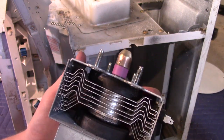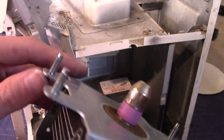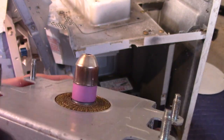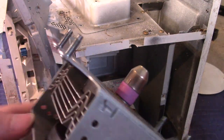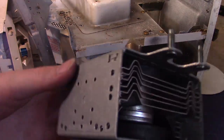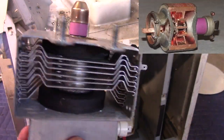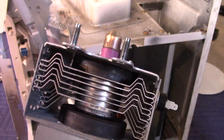You can actually take these magnets out if you're really careful. But there are a few dangers with these magnetrons. You see this little ceramic bit here — you don't ever want to break this, scratch it, or do anything like that, because this ceramic contains beryllium, and that is really toxic. If it becomes airborne and you breathe it in, it will cause serious illnesses. Be very careful when taking this apart. Inside here there is a big copper chamber, and inside that is a filament. That filament is what gives off the microwaves.